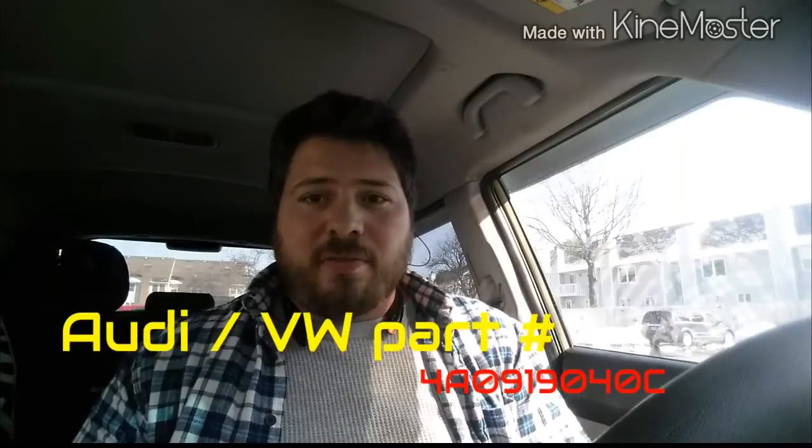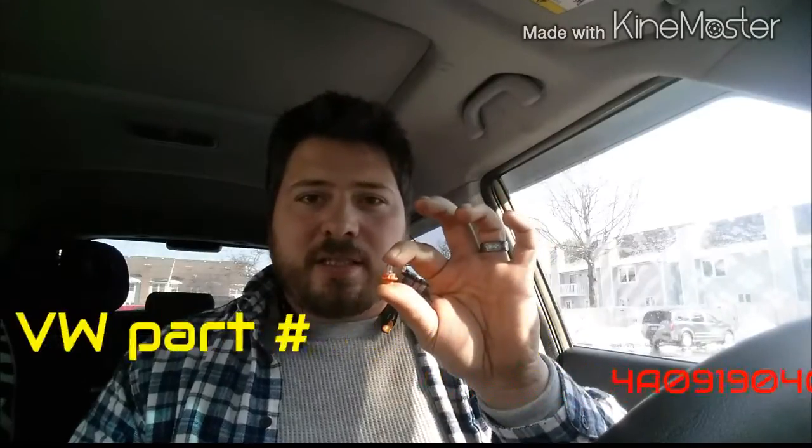So this is my video on how to replace this little bulb. Now there are two of these in the instrument cluster. One is for the check engine light and the other one is for the oil pressure light, and the rest of the lights for the instrument cluster are all LEDs. These are the only two actual bulbs that I could find on the instrument cluster. So I'm going to show you how to take this apart.